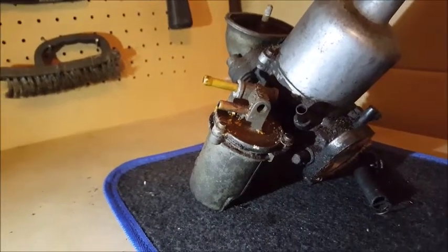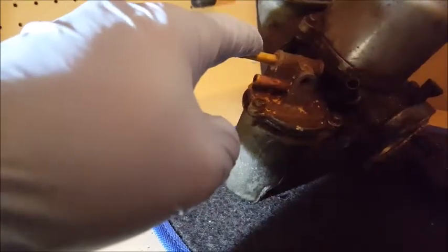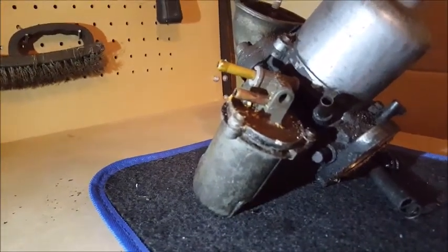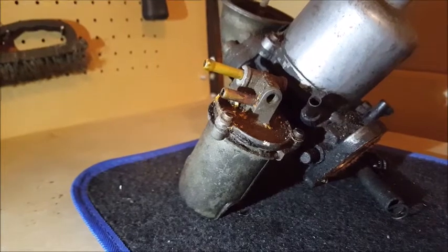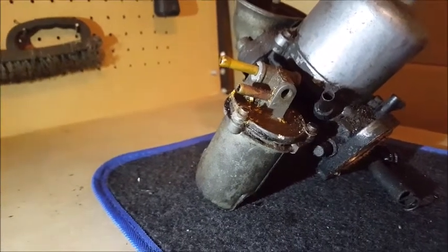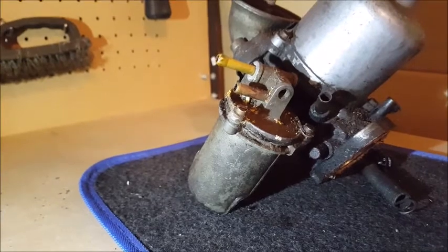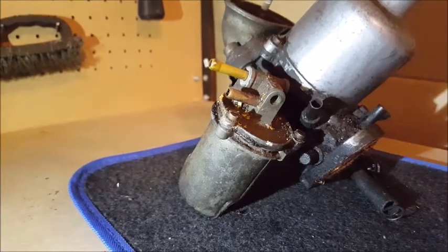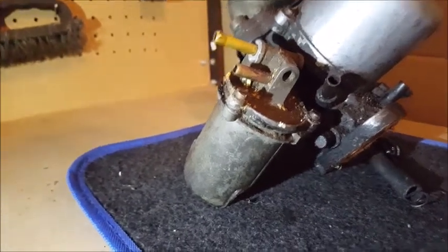Next thing I took off was the fuel inlet pipe, which is this top pipe here. Essentially, it takes the fuel from the fuel pump to the carburetor from the fuel tank. When I disconnected it, I'd already taken out the fuel tank, so I didn't have to worry about too much fuel getting spilled. You can just put a clip on to stop the fuel coming out, and it's also recommended, once you've done it, to put a bung in. You don't want to be cleaning fuel off your engine or anywhere else. So the fuel inlet: you undo the clip and just pull it free from there once it's disconnected.